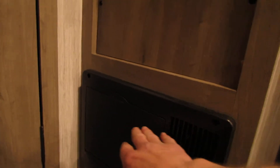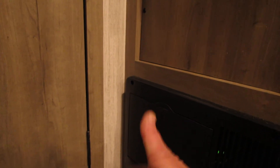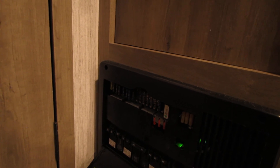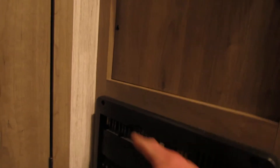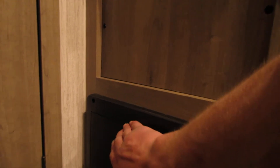There's a nice shower and here's your toilet. Here's your fuse box — it's located just as you're coming out the door of the bathroom and also by the other door to the rear of the unit. You're going to want to check these every now and then. Obviously if something doesn't work, most likely it's a fuse. You'll get a red light that will indicate that fuse needs to be changed out, so keep that in mind if something doesn't end up working right away.